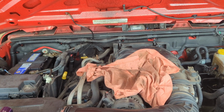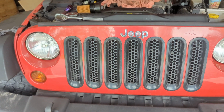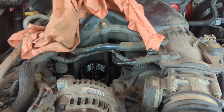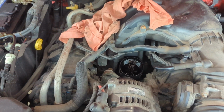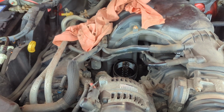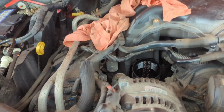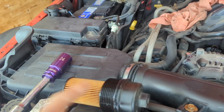So I just finished saying that there was absolutely nothing to see here on this oil change, standard stuff. However, this is my first time doing an oil change on this Wrangler, and so the oil filter lives up here, the housing and everything, and I thought to myself, well, what a great design. This is fantastic. You can take your filter out, not one drop of oil will fall to the ground. Beautiful. Of course, once you pop this cover off, and that cover is literally just clipped in, piece of cake. So here's my new filter. Here's the cap, brand new O-ring, nothing to it.